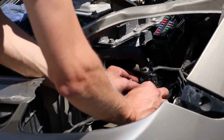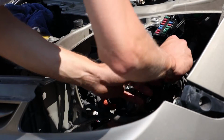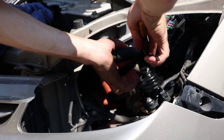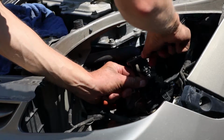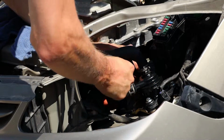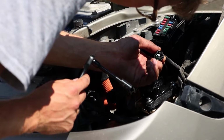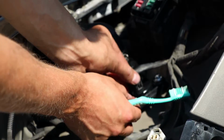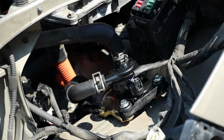After connecting the hoses to your new coolant pump, bolt everything down and make sure your clamps are in a position that'll make them easy to get to if needed in the future. Tighten the bolts, but don't over tighten so as to not strip the threads. At this point I noticed my connector had some green gunk built up at the end, which made me think an interrupted connection may have been the cause for the code in the first place. Oh well.